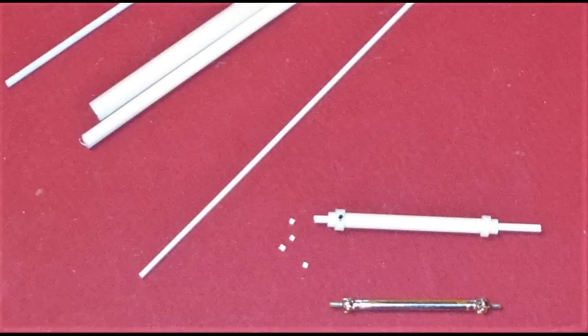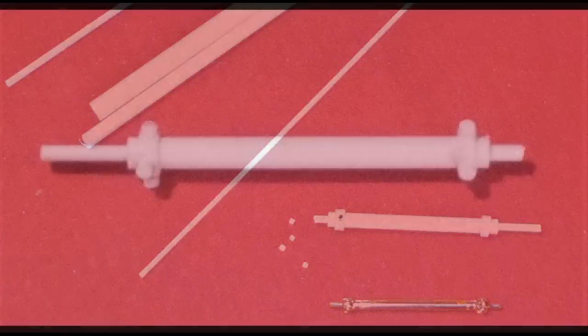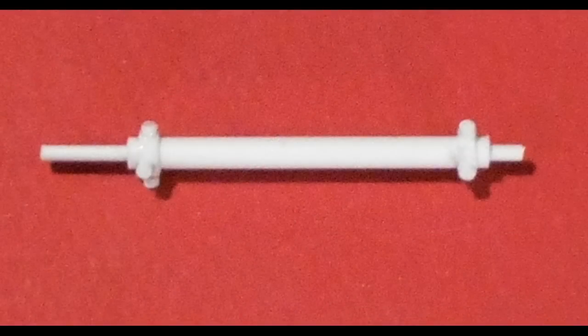Next I began to pay attention to the drivetrain. I decided that the driveshaft that came with the vehicle was a little bit on the small side and a little bit short. So I made some out of the tubing I had pulled out before for the interior bosses and some rod that goes in the center. I cut off some pieces of rod and made the end caps for the U-joints out of it, and put that all together to serve as a beefed-up driveshaft for my hot Chevy motor.